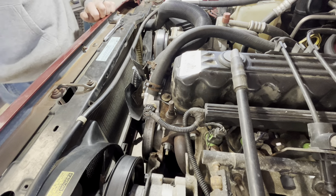We'll go from there. All right, so one thing I've already noticed, this is the pigtail connector that goes from the main harness to the auxiliary fan. See that one pin in there? Kind of wonky and short. I think that pin's partially pushed back. So that might be the whole reason we're not working. This side sort of looks okay. So we'll jumper power and make sure the fan actually works.